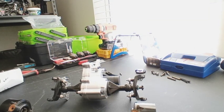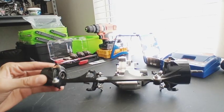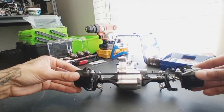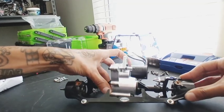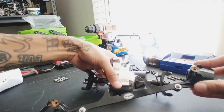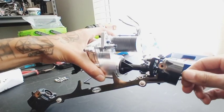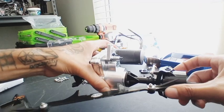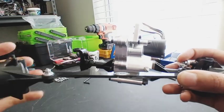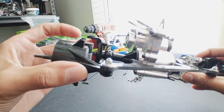Before we put it onto the truck, I did leave out the very last step — we disconnected our locker that locks our steering in the back, so you just want to put those back on. If you slide one out or both sides it makes it easier to get it on there. Just wiggle it — that side's on. Then swing it around and do the other side the same way. Let's go ahead and bolt her back up to the truck and give her a test run.